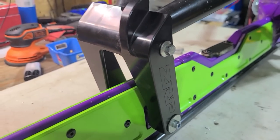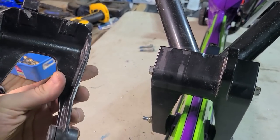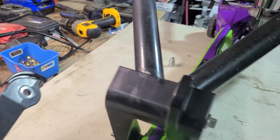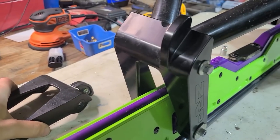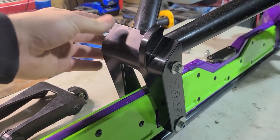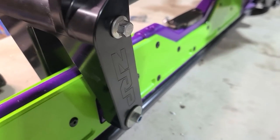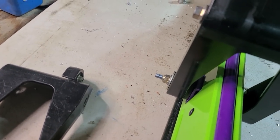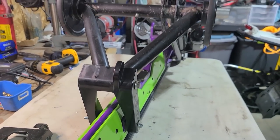There is our new one right next to the old one, and you can see this one's been maxed out a few times on the hyper-extension where it rides on the lower arm — so that's maybe a weak spot too. Quite a bit more angles, quite a bit more meat, quite a bit more material. Stock washers installed — that's the only stock part we're using. We loctited these bolts up here as well. There's our nut on the other side going right through the Alpha rail, updating it like some of the newer ones. Rails are starting to look great.